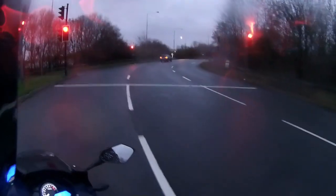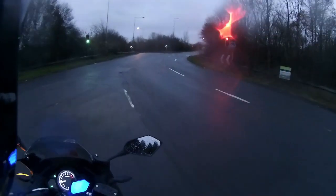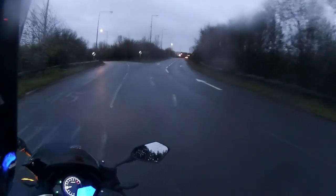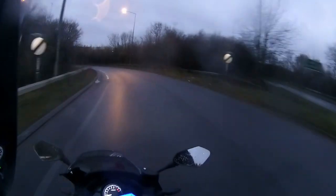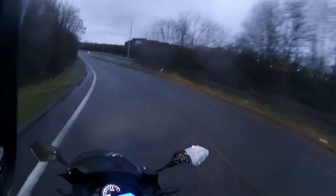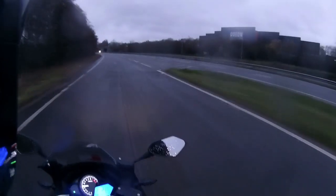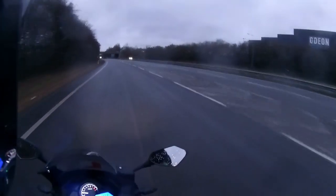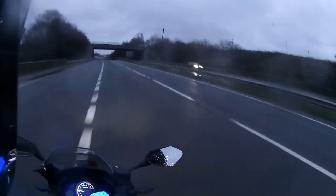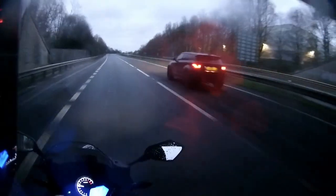We've had comments asking about the quibbles with these LXRs. Another moto blogger - Spicy - picked up that the side stand is a little bit high. It does sit the bike very upright. If you're putting the bike on a side stand - and this only has a side stand, no main stand - make sure you've got a bit of sloping ground. Don't sit it flat in a car park. It does lean over effectively enough but on a slight slope, a big gust of wind could get behind that bike. Always park on a camber.